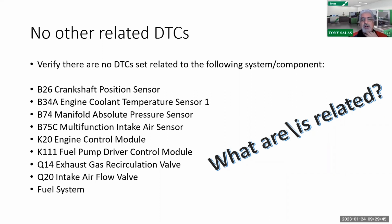So in this case, EGR needs to be inspected, and your intake air system too. Something as frivolous as your air filter can be the cause. But always remember something: an engine is an air pump. The computer is looking for a certain learned speed of that crankshaft every time these cylinders are firing. That means the intake flow and the exhaust flow must be within specification, whatever that is, according to the ECM. If an air filter is restricted, is that going to affect the flow of air going in? Will that affect your combustion process? At that point, will it also affect your exhaust?